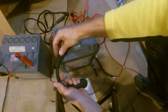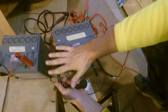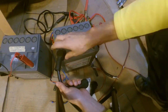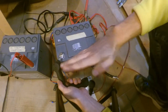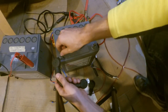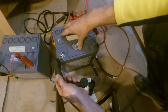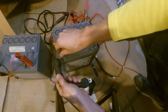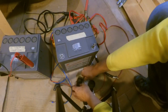So you just make sure you isolate everything, the different parts. You might use this cover, so if you force a metal here, it won't get shortcutted, because if you have it open like this and you get a rod or a metal something like this here, it will melt very hot, it might explode the battery. So always be careful when working with electricity. This has a lot of amp hours and can crank some serious amps when shorted. So always use batteries with careful attention.